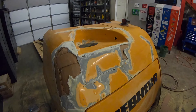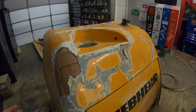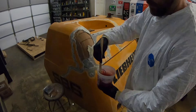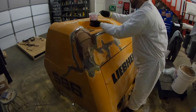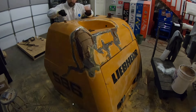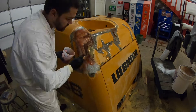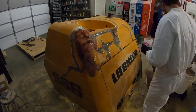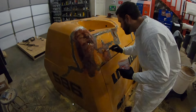I'm going to let that sit overnight, and then tomorrow morning we're going to come in and scrub the whole inside of this unit, take all the screws out, everything we've used to hold it together, get it nice and clean, and do a patch from the inside. Once the inside patch is done, we're going to come and finish and smooth out the whole outside. For this type of work I like to use an unwaxed polyester laminating resin. The reason it's red is we use a MEKP hardener that has a vanishing red dye in it — a visual cue for how much hardener you've put into your resin. When it cures out, it turns clear, working as a visual indicator to show whether the part has cured or not. I also like to brush resin into any of the crevices and cracks before laying any fiberglass mat over the top, as this helps the fabric stick better and wets out the previous old fiberglass area where we've ground.